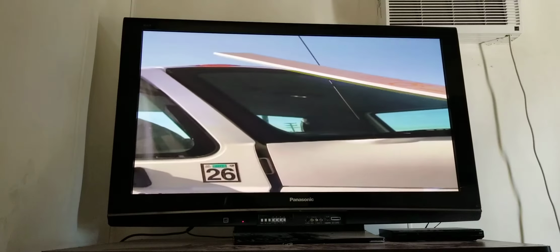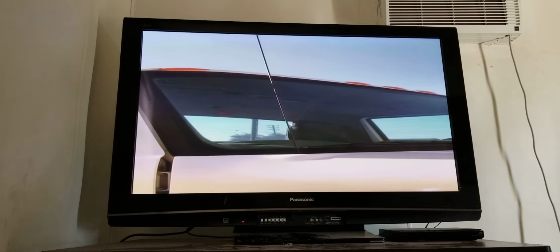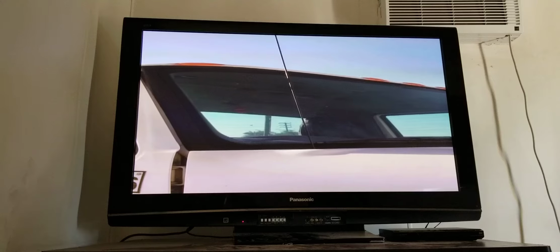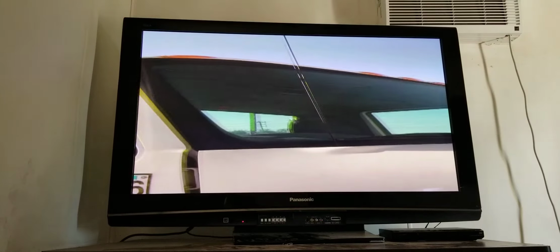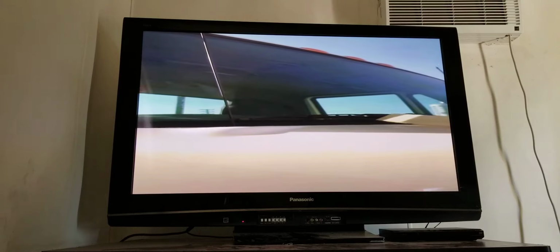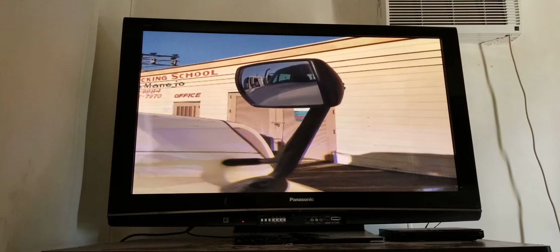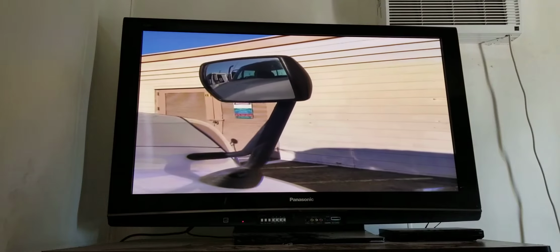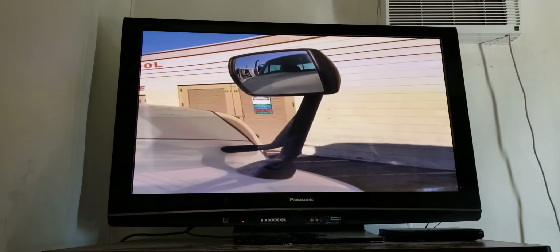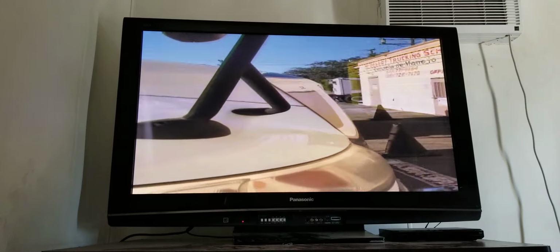I'm going to start at the top with all my ID lights. They're properly mounted, no loose or missing screws, no cracks, no missing bulbs, amber in color, working properly. I have my windshield. It's clean with no cracks. My wiper arms and blades are secure and operate smoothly. I have my convex mirrors. They're properly mounted, clean with no cracks. There's no loose or missing bolts on the brackets, and there's no bends, cracks, or any illegal welds.